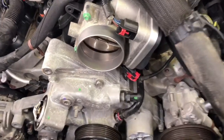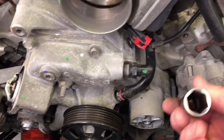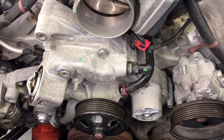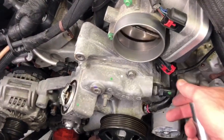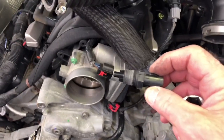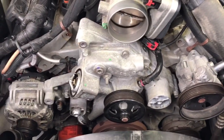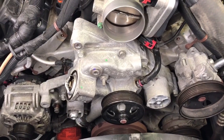A word of advice when you remove the temperature sensor: if you try to put a wrench on there it's plastic and you're probably going to destroy it. I'd suggest using a deep well six-point socket — I used a three-quarter inch, but it's probably actually a 19mm. Be real gentle loosening that up because it's plastic and will break easily. I'm probably going to have to replace this one because the threads just got wrecked coming out of there — so I'd suggest putting a new temperature sensor in. I've got the lower radiator hose out now, so it's basically just a matter of removing the bolts holding the water pump on and it should come right off.